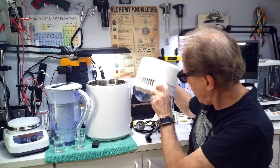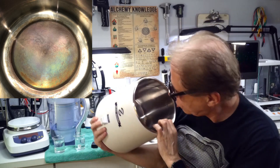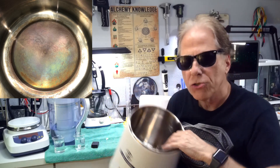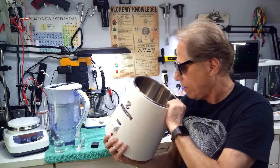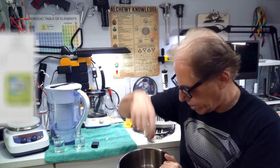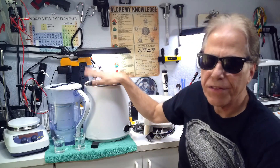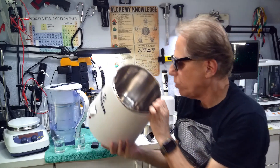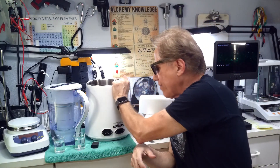One other thing with distillers — you should clean them. Even though I use RO water and Zero Water in my distiller, I still get sediment on the bottom of the tank. The tank is silver-colored, but after about a month's use it'll get a golden brownish color — depending on what's in your water. To clean it, I take white vinegar and pour just enough to cover the whole bottom, leave it in there overnight, and in the morning it will dissolve all of those particles. Then I dump it out, rinse with water to make sure all the vinegar is gone, and my distiller is set to go for another month.